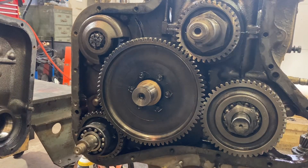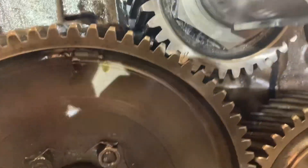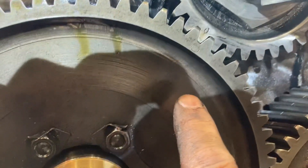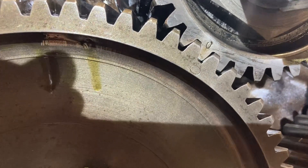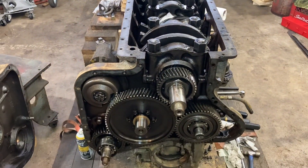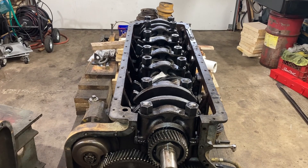So now that we know what marks are what — if you look right there, you can see there's a zero here on the crankshaft and there's a big fat zero on the camshaft. That's where the timing marks have to line up. Once we have that done, then we can pull the crankshaft and change the bearings. Alright, thanks for watching.